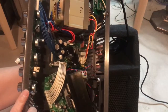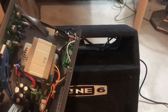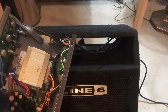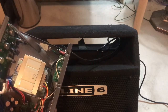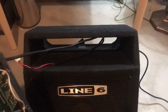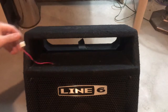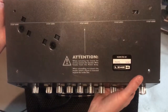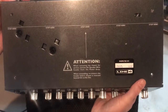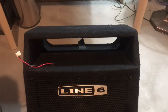The only thing it's going to run into is that speaker wire, so keep that speaker wire flat on the bottom so you don't drag anything over it and cut it. Then the whole thing just slides out. Be careful - you can see how the bottom is exposed. When you're pulling it out, try not to reach your fingers too deep into the bottom where you might touch something with voltage on it, like a capacitor. Most things are not really exposed, but you do have some potentiometers, so I'm not sure what kind of voltages are on there - just be cautious. Then slide the power cord out through the front and you're out.